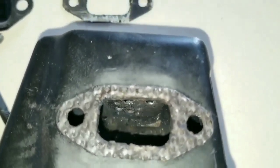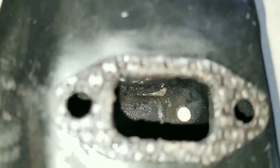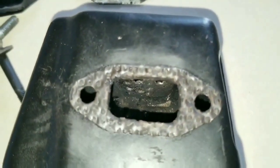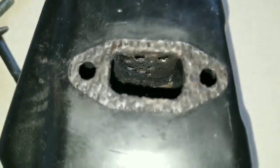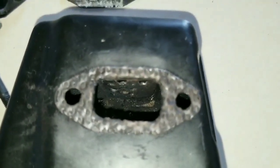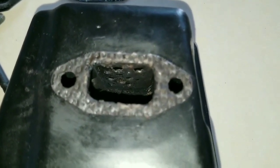With the baffle relocated to the top of the muffler, you're not going to be able to torque those bolts as tight as they were when the baffle was in its factory location. So you're going to need to use some form of exhaust or high temperature silicone where the gasket is going to be placed, if you do not use the aluminum foil layer method.